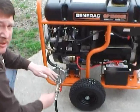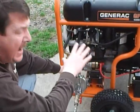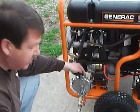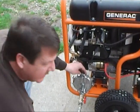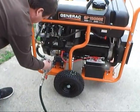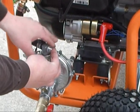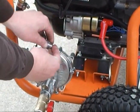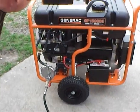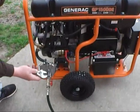Okay, it's at an idle. So what you're going to want to do is run it up to see where your high idle is going to be, because you still might have to adjust it. We'll bring her back down, make sure she idles good. Go ahead and lock your jam nut down.